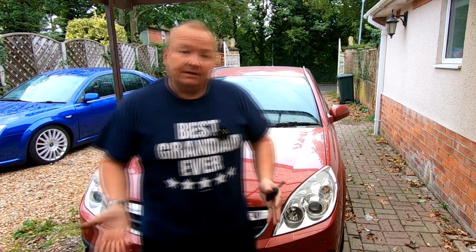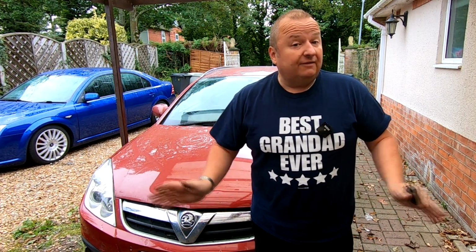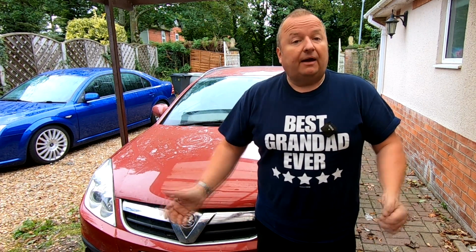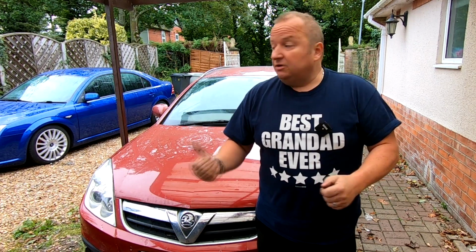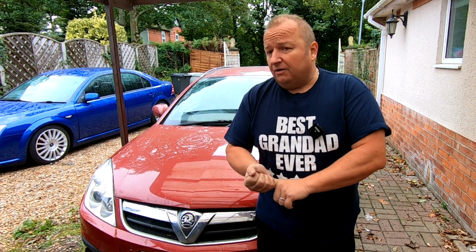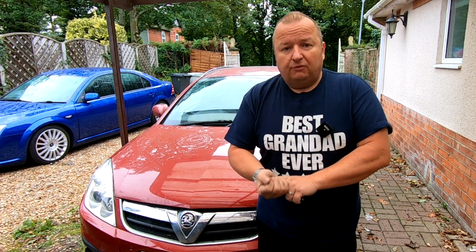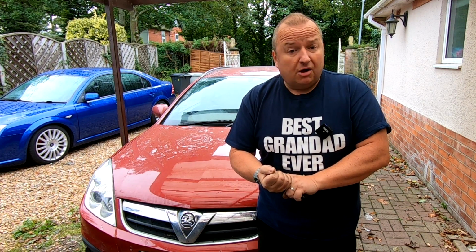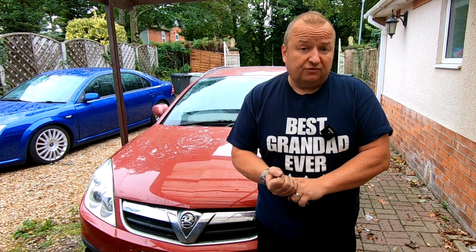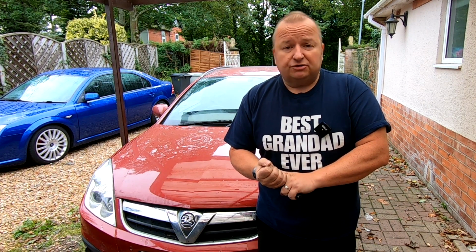The car's back and running, and as I say, it's still got them lights up. I haven't corrected any faults yet on it, no fault codes or whatever, but the car's now running and you can now actually use it. So previously on this car, we've done a temporary DPF clean. We've now changed the inlet manifold, and we've done a swirl flap delete, and we've also put a different EGR valve in because the EGR valve that was in here was letting by, as we've seen in the previous videos. It's still got a DPF fault light come up with regards to the sensing tubes.